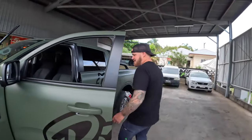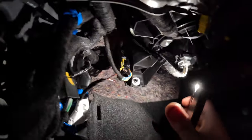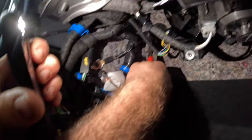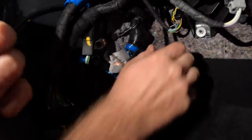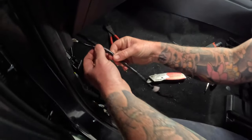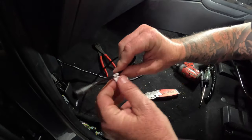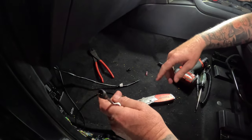Come around here — we've got Benny inside doing his thing. Down by the grommet, that's where the wire comes out from. He's got it through! Now we've got our wires pulled through. You'll see here's our bit with the tape — we'll just tear that bit off. This wire is labelled 'switch', so this is going to go through to the switch we showed earlier. Now this is the important part — this is the high beam infeed, which Ford's been kind enough to label 'high beam' right there. It comes pre-done, ready to go.